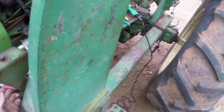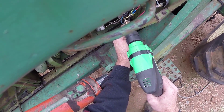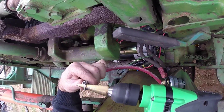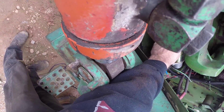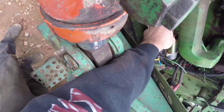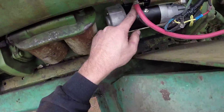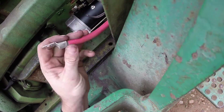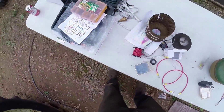That's a little tight so I'm going to take my drill and ream that hole a little bit. I just don't like it when they're so tight — they can mess up the threads. The other thing I'm going to do before I do this: I'm sitting here looking at this other solenoid post right here that isn't used — it's still open — so I'm actually going to tape that up to ensure it doesn't touch anything. Let me get my electrical tape.